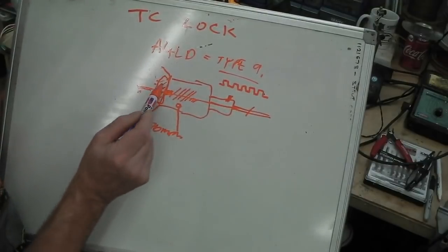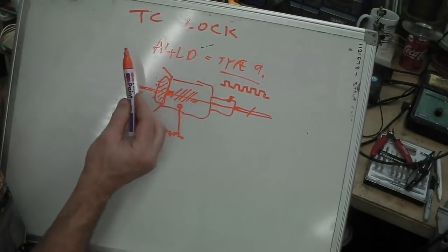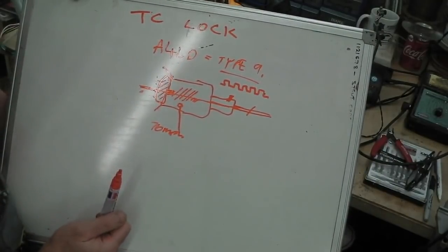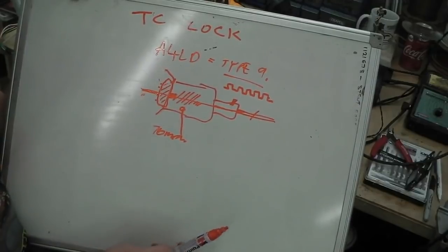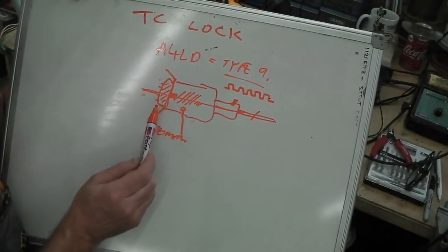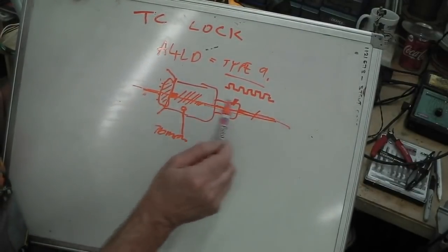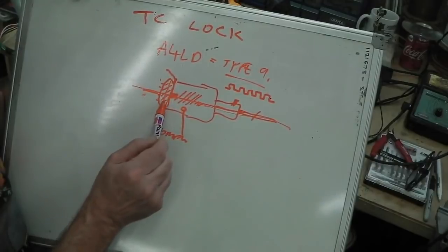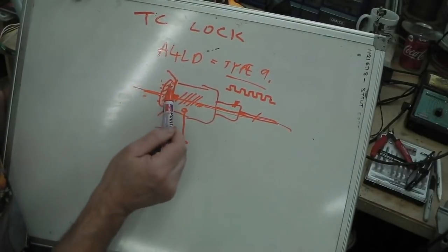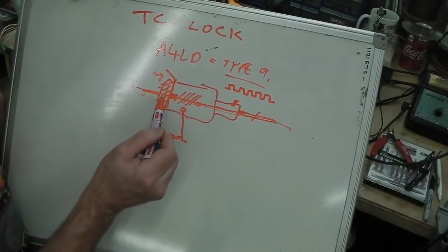You'll never get it exactly the same because this lockup isn't always engaged. But when you're into your cruising motorway miles, that's when it starts to catch up with a Type 9. Round town, you'll not do it. But on long distance driving, with this lockup engaged, with a one-on-one drive, no torque converter, it's going straight through the car. It's locked solid. It eliminates the torque converter, so you can cruise and not have that around 10% loss of power in that torque converter.